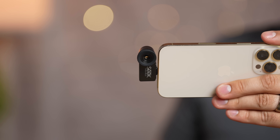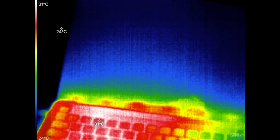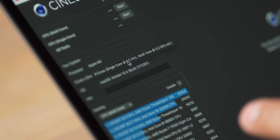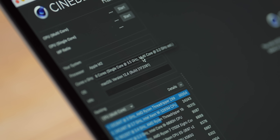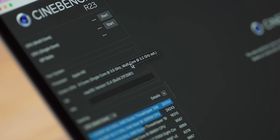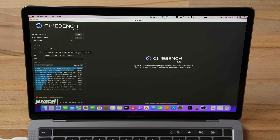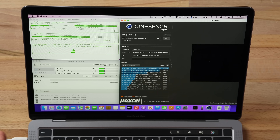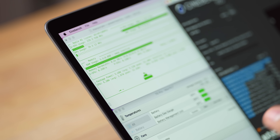Before the harder tests, let's check the thermal camera. Just sitting here after those simple tests, it's at 30 degrees Celsius at the hottest point. Hovering over the M2 chip in the software, it estimates single-core at 3.5 GHz but multi-core slower at 3.2 GHz. The M1 ran the same frequency regardless, so let's see what actually happens. Starting with a single-core test.